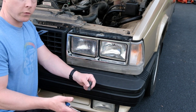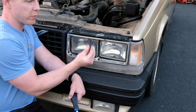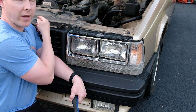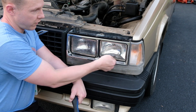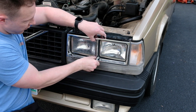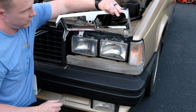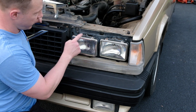Just like everything else on this car, the key here is that this is old plastic — you don't want to force anything, take your time. Before I started filming I went ahead and removed these clips right here; they go down through a square hole and they're sort of spring-loaded. My passenger side clip is already broken, but this one is intact, so just take your time with these. When you remove the chrome bezel, note that it sort of hooks around some things, so look in there carefully. It should come up without any real force — generally you want to go up and then pivot it out. And there you can see some of the connections that exist on that bezel. This is basically just some flathead screws.